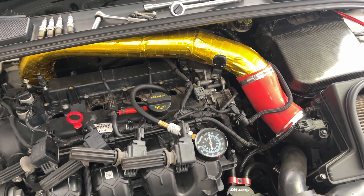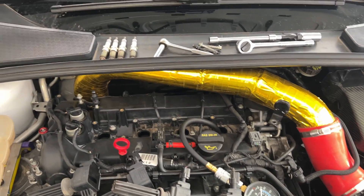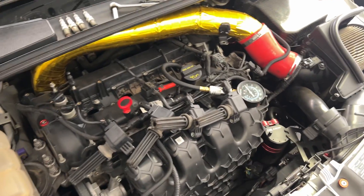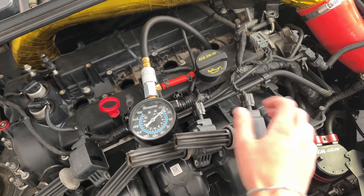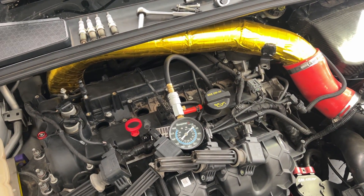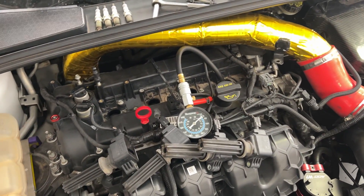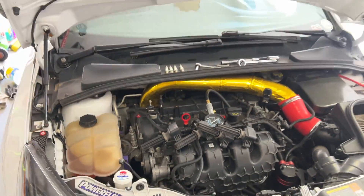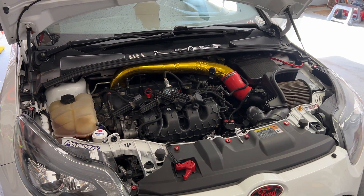For me it was about five to six seconds for that to work correctly. Make sure to check your spark plug gap when you do this just to make sure everything is healthy. Hopefully no one watching has a low compression reading. This is a pretty easy thing to do — I used to think I'd have to take it to a shop, but anyone can do it. It's a great way to check the health of your engine. Please leave a like, subscribe, and follow me on Instagram at nickjonette, and I'll see you in the next video.